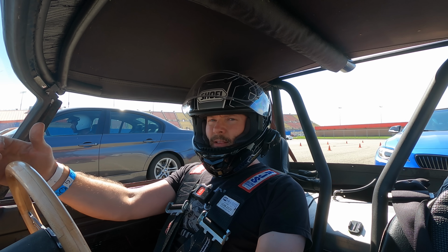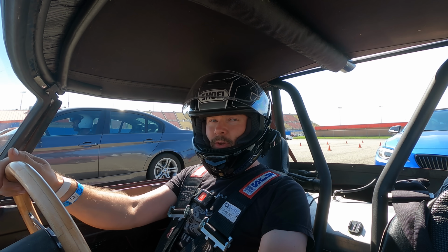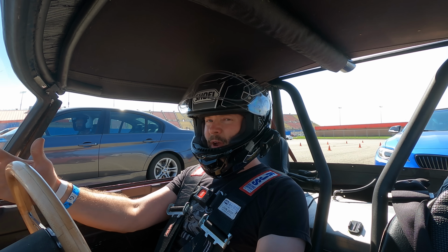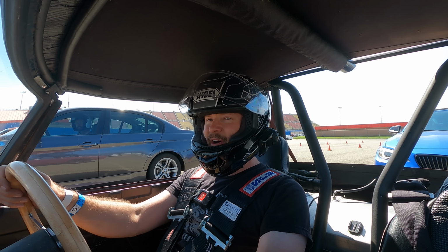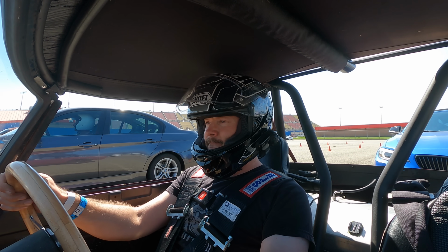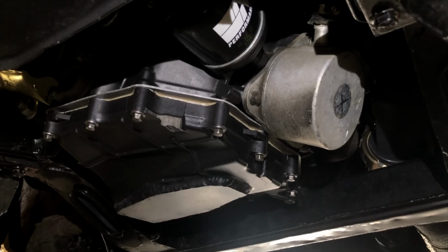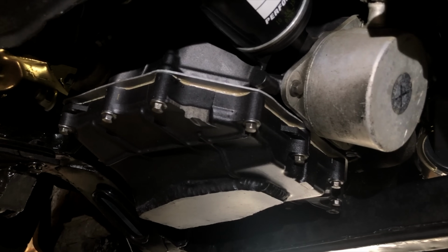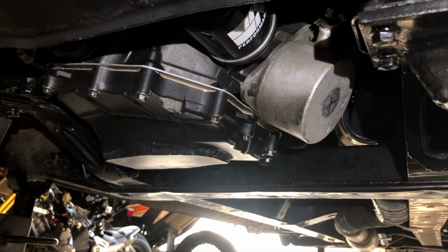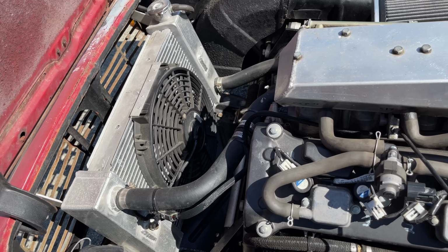It's not getting great launches, and it gets worse as I cycle through the queue. I think the oil is getting hot and the clutch is getting worse. I might have actually toasted the clutch on this thing. I got a lot of miles on it, and this is a much heavier vehicle than it was designed for. The fan isn't set to come on until 200, which would normally be fine, but it also has less oil than normal since I modified the tall oil pan to be shorter so that I could fit it under the hood. This has never been a problem before cruising in the canyons. This car is always moving enough that the fan almost never comes on.